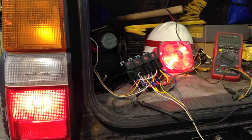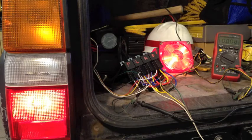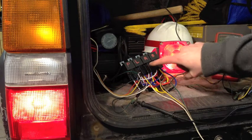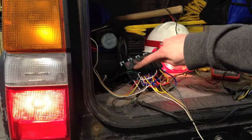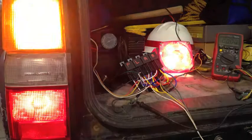Okay, this bloody mess is my new version of this bloody mess. So, it's just 4 relays. This one's all on its own, this one's for the parking lights, taillights, whatever you want to call them. This one's left and right high filament, and this is brake. I'll throw up the schematic I used. I found this online. I did not come up with this. It's real simple. You only need the 3 relays. I just added the park light relay, just so that was relayed too.